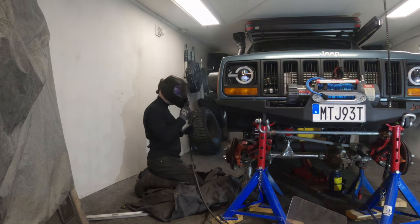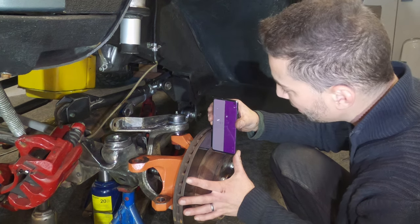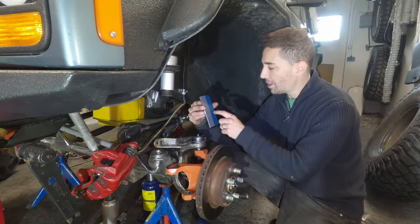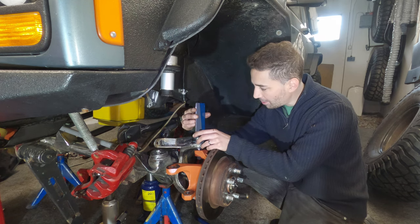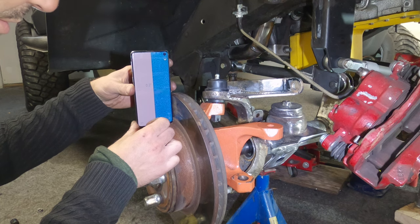It's been quite a lot of work to get this all set up. I've got it within 0.1 to 0.2 degrees into the negative, so that should be an extremely straight tyre. In terms of caster, I wanted to aim for about eight degrees and I'm over that — basically at nine. This side's pretty good too, though at 0.3 degrees into the negative.